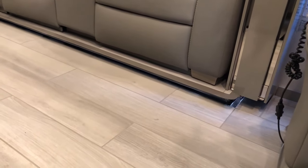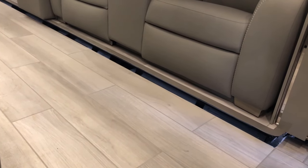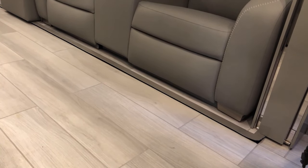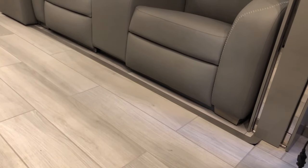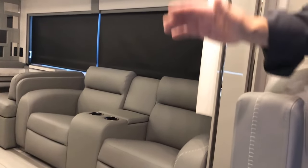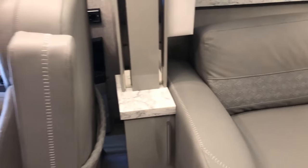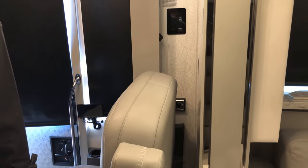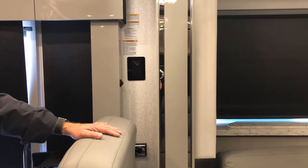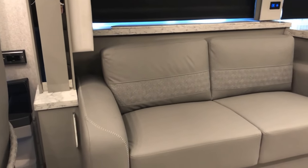For the full-wall room, hold your finger down until the room goes all the way down to the floor — it will shut off automatically. Just leave your finger on it and it shuts off, then release. To run the kitchen slide out, press and hold out the same way — the pump will shut off automatically and then release your finger.